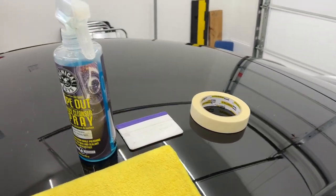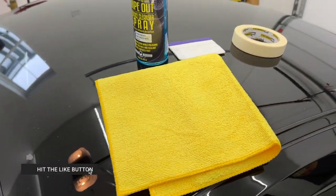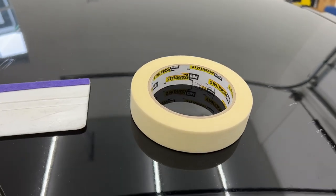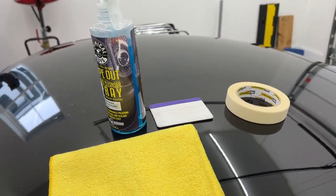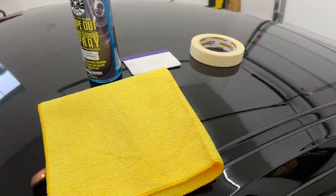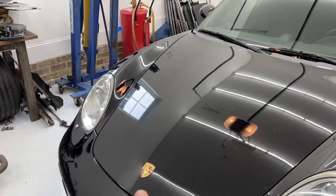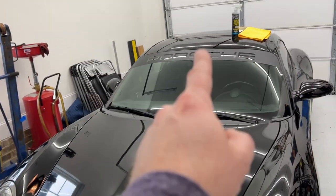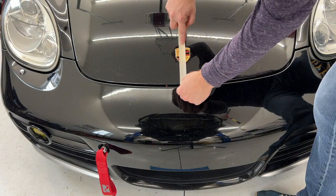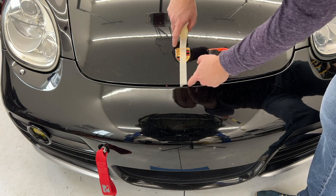Let's do a little prep work. I'm going to use this surface cleaner to make sure I get wax and contaminants off. Some people just use isopropyl alcohol mixed with water at like a 70-30 ratio. I got some masking tape where I'm going to lay out where I'm going to put these first, and a little felt-covered squeegee to help apply the vinyl. Since this vinyl is going to be offset over here on the hood, the first thing I'm going to do is mark the center of the hood and put a line down it and all the way down the car. For the center, I won't be measuring — I'm going to assume Porsche put the crest right in the middle and use that as my middle mark.